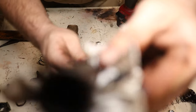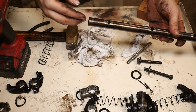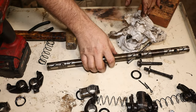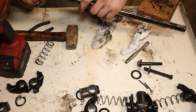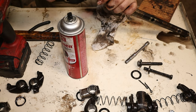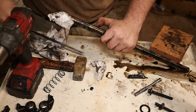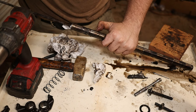Now I'm going to try to get this one — you can see up in there, but it's going to be kind of difficult. This will be the time when you go ahead and clean it with a bore brush if you have one — maybe for about a 20-gauge shotgun or something — and just run it up and down in there until it's clean. I do not have one at the moment, so I'm just going to spray it with the brake clean and take that same rod and run a paper towel down it continuously until it's nice and clean. You can see all the junk that's on that paper towel. I'll just keep doing that until it comes out clean. My engine looked really clean on the inside, but these were still all gummed up, so it's certainly worth checking no matter what your engine looks like.